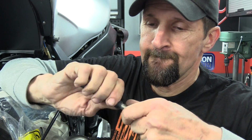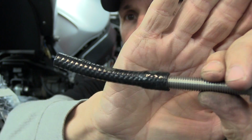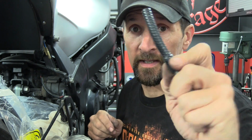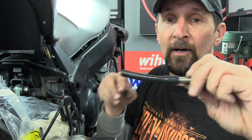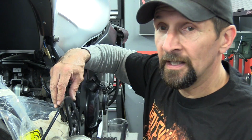And that's just as an example. That's what you get. It stretches the end out like that. Now what I'm going to do with that, if it was a cold day, you leave that on a heater or a radiator just to soften up. You can put it in boiling water if you like, that will soften it right up. But just leave that in there for about an hour, and then when you take it out, that end will be a bit baggy. It does shrink back, so as soon as you take it out, get it straight on there, put the clip round it, that's it, it's on, super.